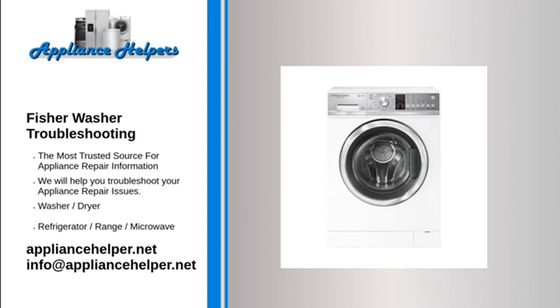Water is coming from the bottom of the washing machine. Check that the drainage hoses are not damaged and are fitted correctly — if not, adjust and try again. Monitor the wash cycle when you suspect leaks. Too many detergent suds can cause this problem — check that you are using the correct amount of a front loader specific detergent.